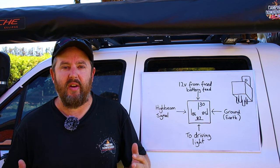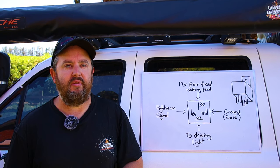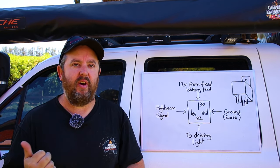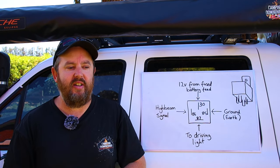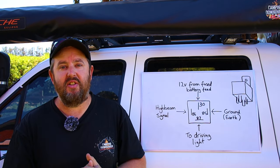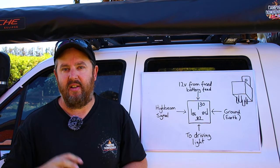The next reason that won't work: in Australia we have road rules, and any light bar or spotlights have to be triggered through your high beam switch. So why can't you just run the positive wire from the light straight to the high beam? That should work, shouldn't it? Well, your lights aren't designed to handle that much load either. Same thing again — you need to run power straight from the battery, not from your headlight.